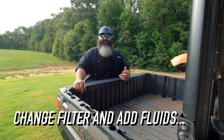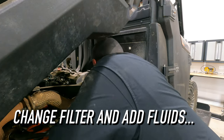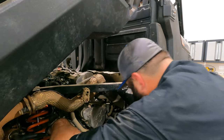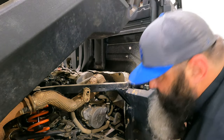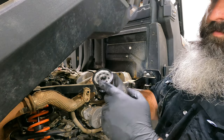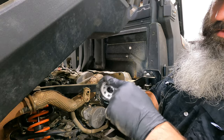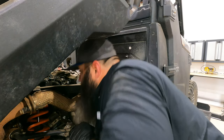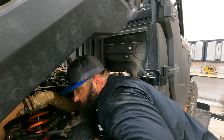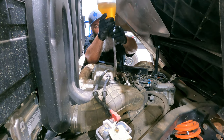Second, oil filter and add fluids. You'll want to remove the oil filter first. If the filter socket is a little loose like ours is, add a rag and it'll be tight enough to get it off. Once it's off then I apply oil to the seal of the new oil filter and then I hand tighten the new one on. I'm not saying this is the way you have to do it — I'm just explaining how we do it. After that part's done then I move on to filling up the engine oil with the exact amount stated in the owner's manual.